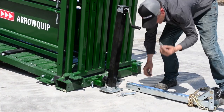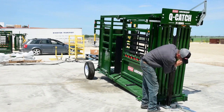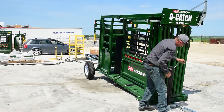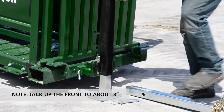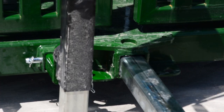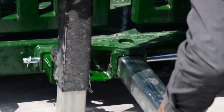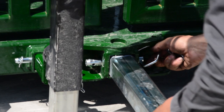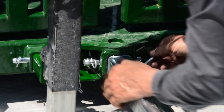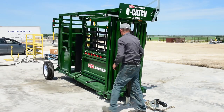The jack is pinned on to the receiver. Now you can put your hitch in position, pull the pin out — it has an R-clip on it — then start jacking up. Put your hitch into the receiver, put your pin in, and make sure your R-clip is on. Then finish jacking it up to the height of the hitch on your truck.